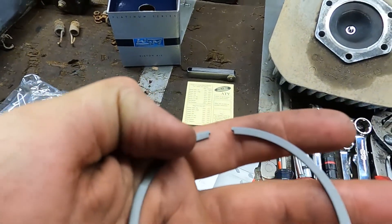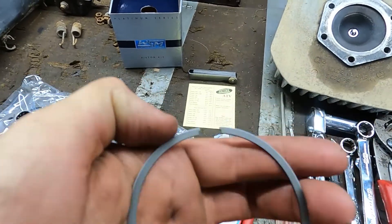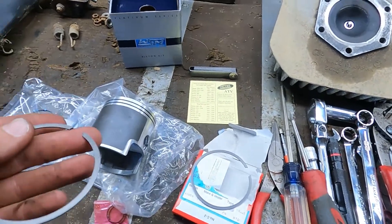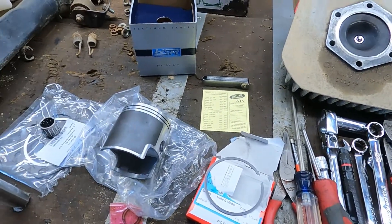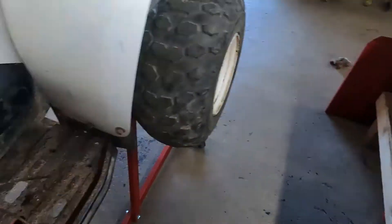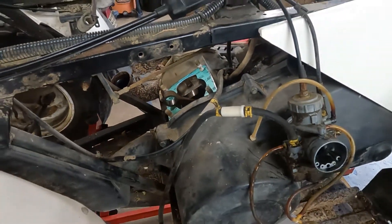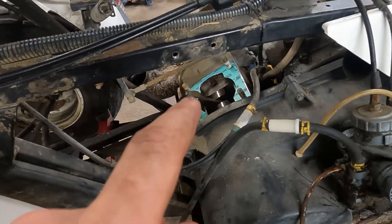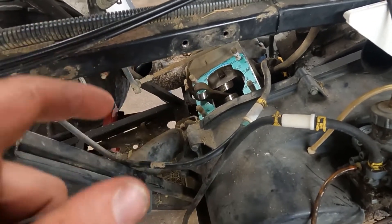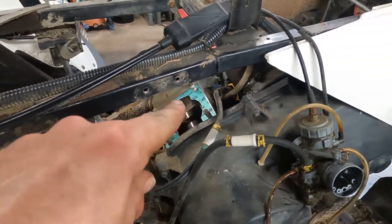Now that we know the ring gap is good, we've got to install the rings. If you look on the bottom of the ring there's a letter R stamped on one side — the letters go up. We're going to put the rings on the piston with letters going the same direction. We're going to start oiling up our wrist pin and wrist pin bearing. I already have the base gasket on there — don't forget that. I've had to do that a lot of times: get the cylinder started down on the piston and then realize I forgot to put the base gasket on, so I'd pull the cylinder back off and then try to get the ring squeezed back in the cylinder again. Don't forget that part.